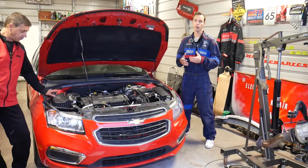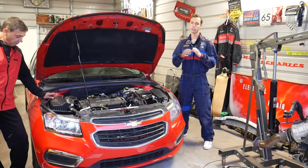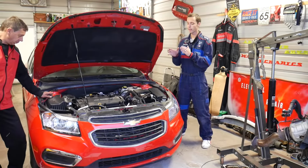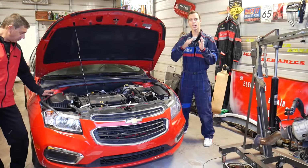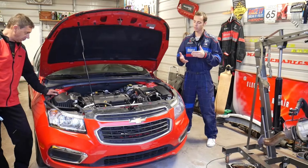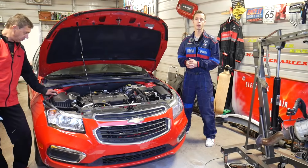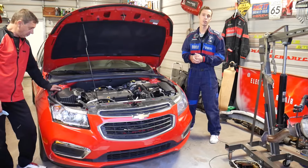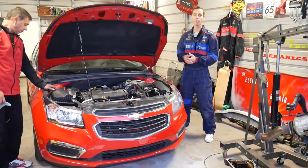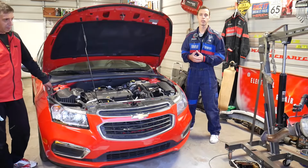Stay with us, it's very important on newer vehicles. It's not like the old school manual pedal. This pedal has a few switches inside of it that tell the throttle body and the car computer how many percent the throttle pedal is depressed, so the computer knows exactly how much fuel to give and all that stuff. All of that needs to be functioning perfectly, otherwise you'll get an engine light, your car may go into limp mode and it may not have power, so you can just get it off the road. And in today's video we'll explain what needs to be done to replace it.